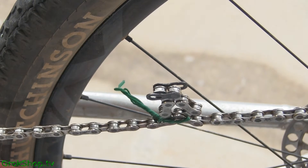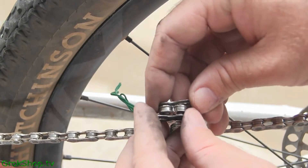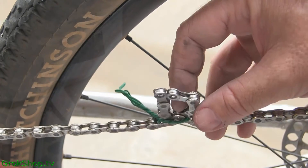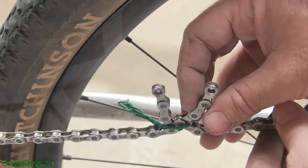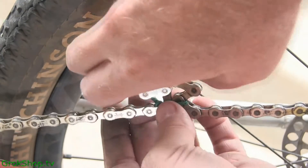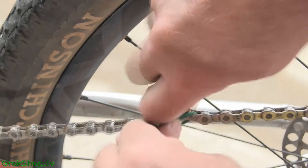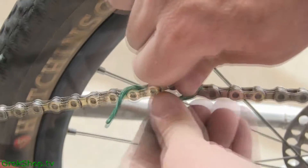You can also use pliers — I've even used needle-nose pliers before. If you carry some twisty ties and a small wrench on the trail, this works great if you need to bust it apart. Heads up with this little trick: make sure you're holding both sides of the chain when you remove the twisty, otherwise you could get some pretty serious chain whip.